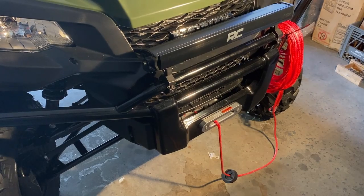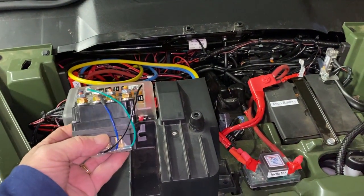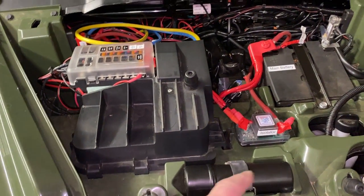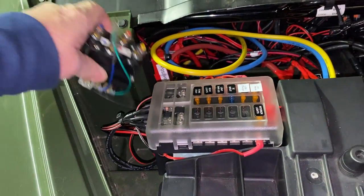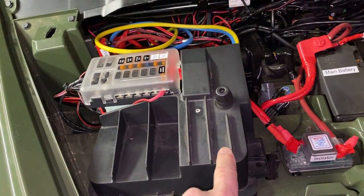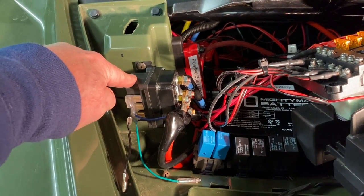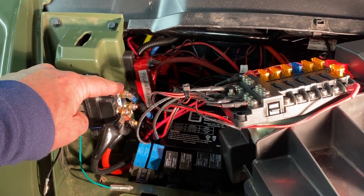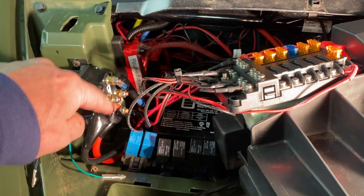In planning the wiring layout, one of the major things is to figure out where the contactor is going to go. Some people put their winch contactor up front, but we've already used that area for our isolator. We're going to mount it right back here. We have our contactor mounted. The four heavy cables — the low-gauge wires — have connections: blue and yellow go to the winch; red goes to the positive bus, black goes to the negative bus.